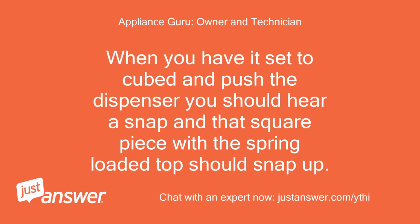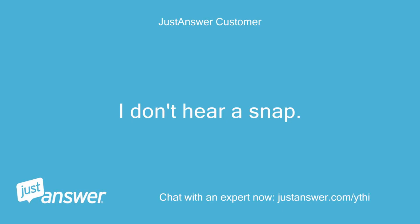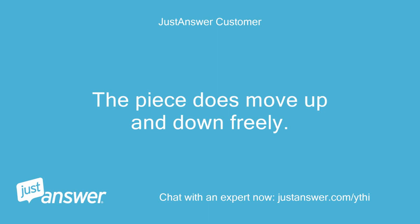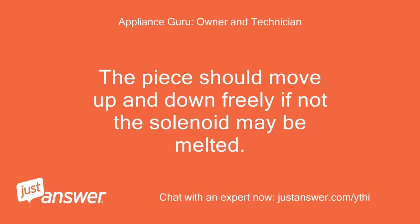When you have it set to cubed and push the dispenser, you should hear a snap, and that square piece with the spring-loaded top should snap up. If it is not doing that, press the piece up. Does it move up freely? I don't hear a snap. The piece does move up and down freely. Attached is a shot of the piece as it sits. The piece should move up and down freely, if not the solenoid may be melted.